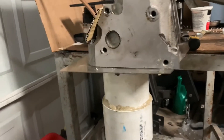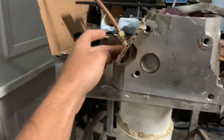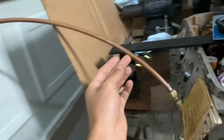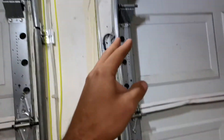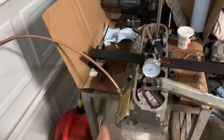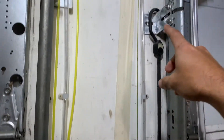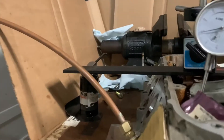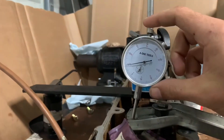So at that point, how do you know what it's doing? Well, you take a spark plug, knock the center out of it, attach some brass fittings to it, and hook it up to a piece of copper pipe. That copper pipe runs to a tube that runs all the way up here. I've got a measuring tape here — this tube you fill up about halfway with water. As you cut on the shop vac and send suction through the system, it'll start pulling the water up the tube. You control the valve with a micrometer or a dial indicator.